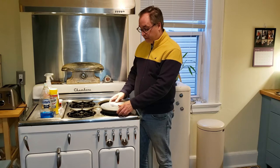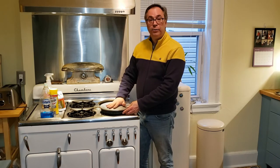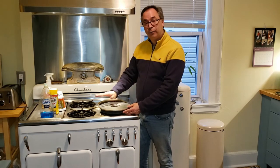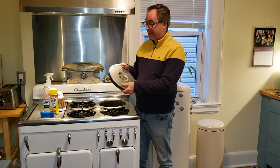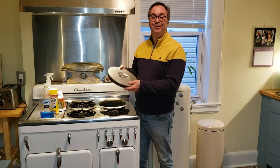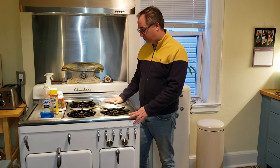Of course you can replace them, but there's a finite number of thermo-well lids and everyone wants one — and a cleaner one. You can have a cleaner one that's still intact; just don't let water get inside. When you clean it, get one of those green Scotch pads, wet it, sprinkle Cameo Cleaner onto the pad, and rub it on. You can be reasonably aggressive with any stains on the aluminum top. At the end, just brush the Scotch pad in one direction — that'll get rid of a lot of the swirls. It's 70 years old; it's never going to look as good as new, but you don't want it to be disgusting. Cameo Cleaner and a Scotch pad carefully, then wipe it down with a damp paper towel until all the residue is off. That's it. Never submerge it in any kind of water, or you will ruin it.